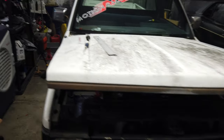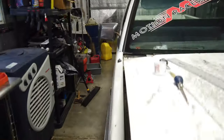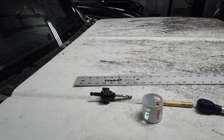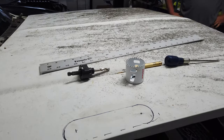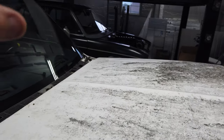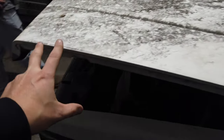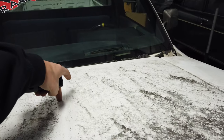Bernie's got a hood — well, not quite. I'm not sure how we ended up with headers that were a little tighter on this side than the other when we used angle iron on both to hold spacing. This side is a little bit tighter, so it's going to be real tight up against this rib right here. I'm trying to go just to the inside of this rib so I keep the structural support and notch the hole. It's pretty tight — I'm guessing I'll have to open it up a little bit. This side's going to have a little more gap. Also the center hole — it's probably not going to be centered because the engine sits off-center in the truck.